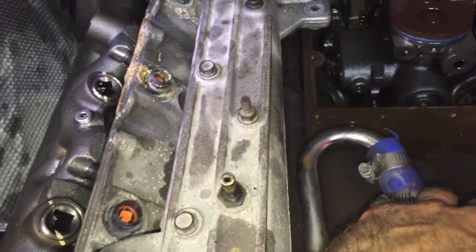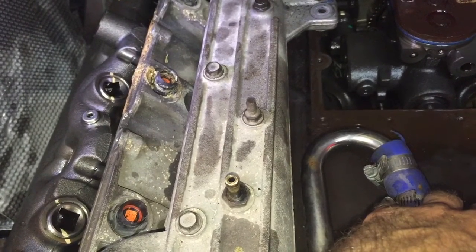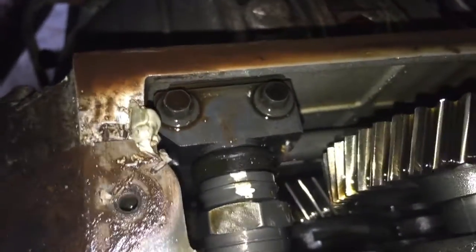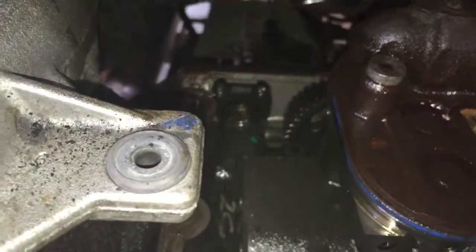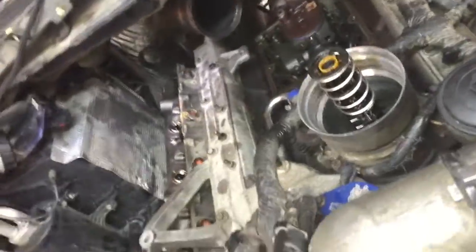Now we need to really hope that it leaks right there at that fitting. If it doesn't, we are at a branch tube. So Julie is going to connect it, and we're going to watch it right there. Here we go. Wow. You can tell it's the first time I connected it. So that is a blown out STC fitting. So we're going to go ahead and get the STC fitting done. He's going to have standpipe, dummy plugs, and STC fitting when he leaves. He's already studded.